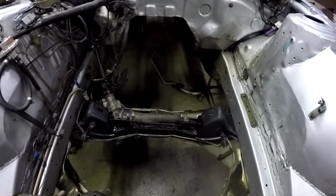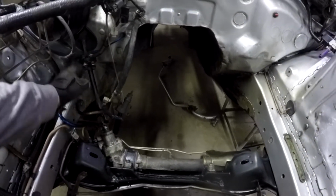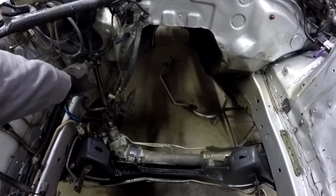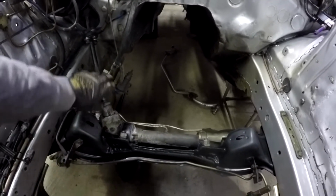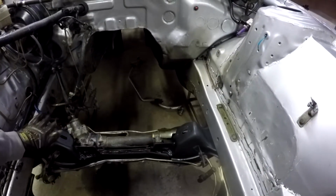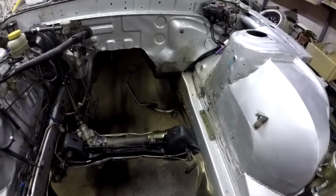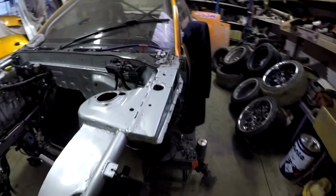Got the anti-roll bar removed, and I have this steering column all in place there with the washers. So I've extended the steering column down 4 washers, which is 2 apiece, 8 mil. So that's all catching, that's all good. That's all steering column and subframe into place, tightened up, so I'm happy with that. The next job is to start into the steering kit, as I said.